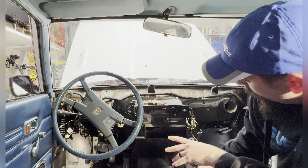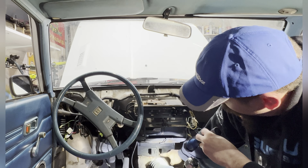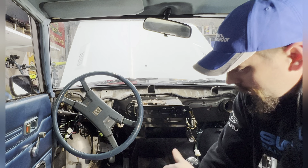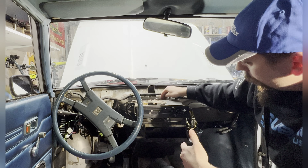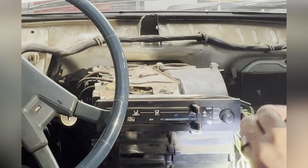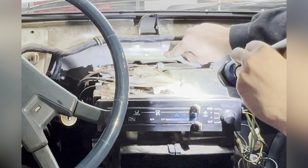Now that the dash and radio controls are out of the way, the main things holding this on are going to be a nut right here, a nut right here, and then two nuts down in here. Aside from that, the last thing I'll have to do is unhook the coolant piping to the heater core. Just a heads up — it's going to feel like there's still something holding this on, but it's because this was either glued or had some kind of really sticky foam. Right now it's just kind of crusty, but I had to trust that I got everything and pull hard — and it came undone. You can see it was some sort of gasket here with foam on it, so give it a really good tug.